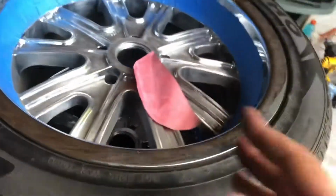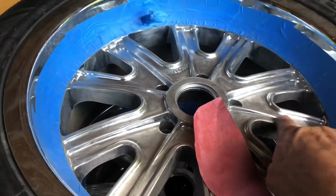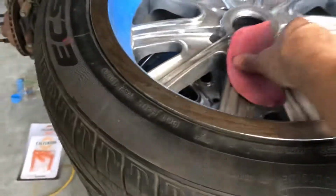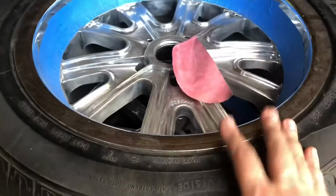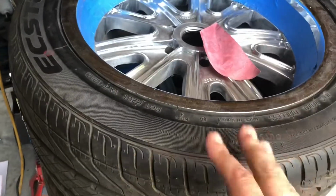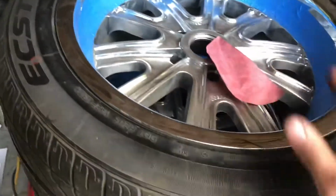And I've seen some guys attack their chrome with like 60 and 80 grit, and I'm not going to have that. That will leave huge work marks in your paint job after the fact. 220 has fine scratches. It increases your surface area by 50%, 100% over the flat surface by putting all these fine scratches in there.